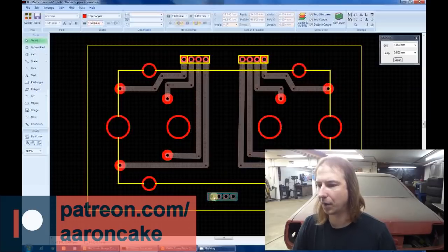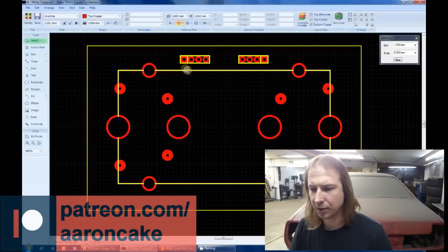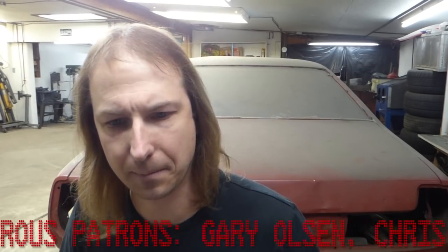Now recall that I already created the board mounting pattern in episode 48, so now we just need to add the components. I like to start with all the connectors in this case. So I'm going to use some Molex 90-degree board connectors. And notice that I'm working on the top copper level because the motors are actually going to be below the board, so I'm going to be soldering on the top, which makes it really handy because I'm going to have to use some surface mount parts.